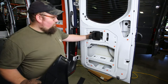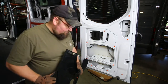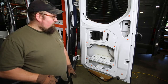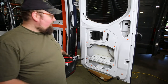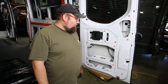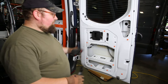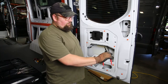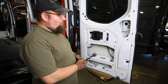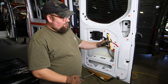That's a point where you want to be really gentle because you don't want to break the edges of your door handle, as that is a piece you'd have to get from the dealership and replace. So if you got all those off, then you're ready to start doing hush mat and insulation. A quick note: when you remove your panel, you'll probably have a lot of fasteners still stuck in the door. We're going to want to get those out because they need to go back into the panel. We have a fancy tool you can get at Harbor Freight or on Amazon to pop them out, but you can also use a flathead screwdriver or a normal upholstery tool.